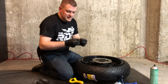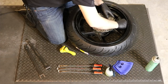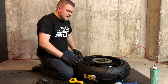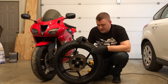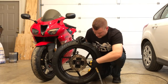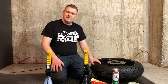Now we need to reinstall our valve core or put in a new one depending on how old your tire is — it doesn't hurt to always put in a new one. We're going to use our valve core remover and go ahead and put that back in. Now the next thing we need to do is inflate this tire and pop the two beads. We'll go up to the garage and use the air compressor. This could take anywhere from 20 to 40 PSI depending on how difficult the tire wants to be, but you will hear two audible pops when the beads set.